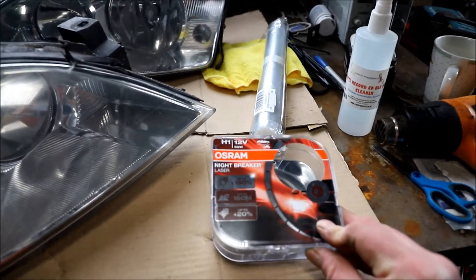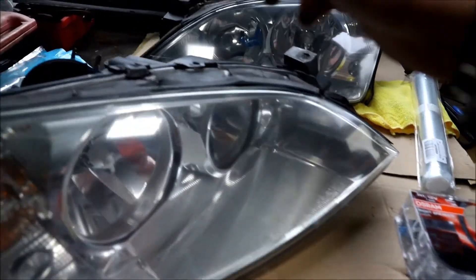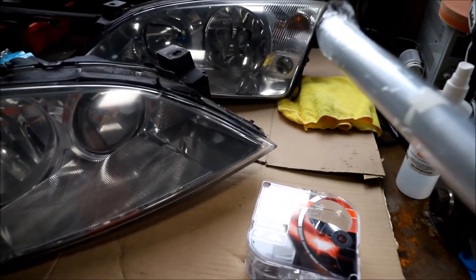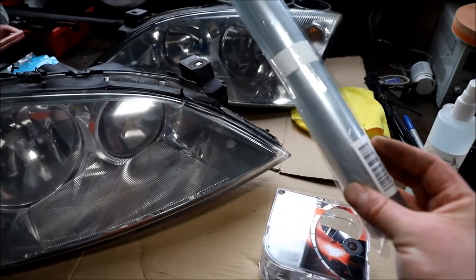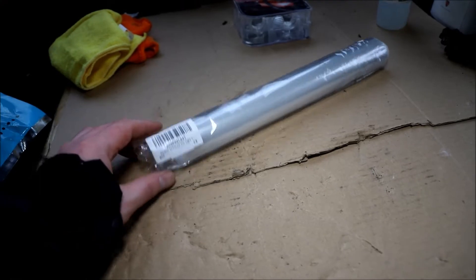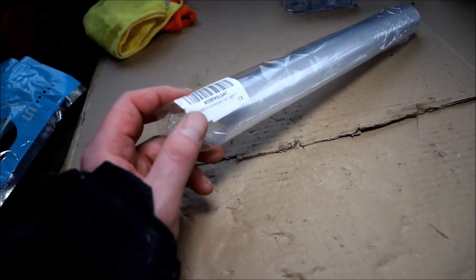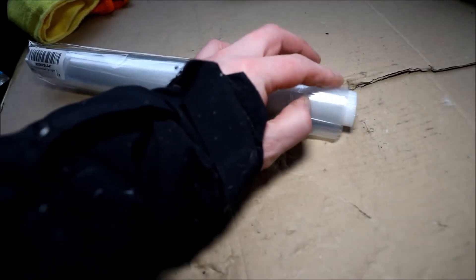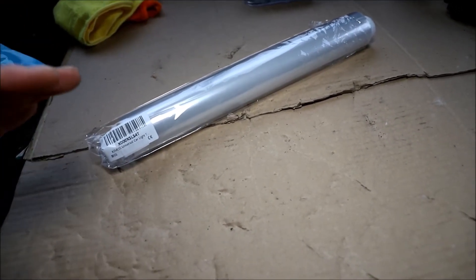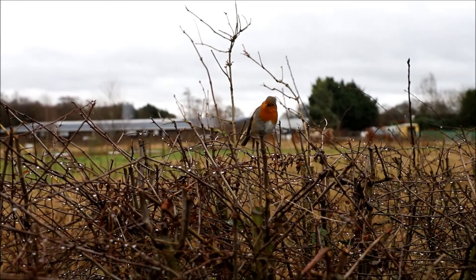What I'm now going to do is fit the H1 bulbs — the H7s are already in — then repair the backs, drill a hole and put a cable tie through the back covers to keep those in place. I'm then going to apply the UV wrap once I've cleaned the lenses with isopropyl alcohol and a microfiber cloth. The new bulbs are in and the lights are all tidied up. However, this film is not what I expected at all — it's made by Kimiss, it's way too thick and it's sticky-backed, so it's going to be a nightmare applying it. If you know anything else you've used — the water application stuff would be great — please post below and I'll fit that another time.